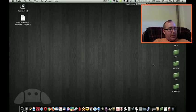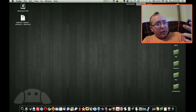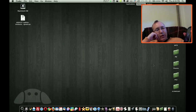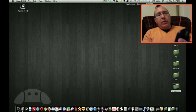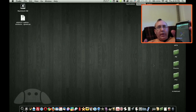Turn off USB storage and I'm going to reboot the phone. So now what we want to do is boot into recovery mode — hold down the volume key, press power, keep holding the volume down key until we get the white screen. Then we're going to use the volume key down to select recovery and hit the power button. At this point we need to wipe the phone again, even though that happened during the bootloader unlocking. Select the fifth option down — wipe — click the trackball, wait for the process to complete, and then get back into recovery mode. Hold down volume down, power — that'll take you to the white screen with the skateboarders — select recovery again. And here we are back in Amon Ra's recovery.